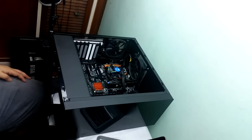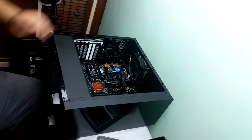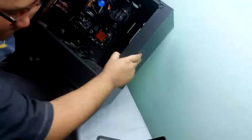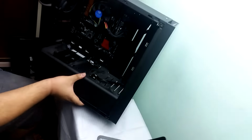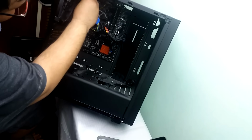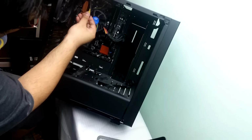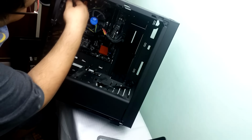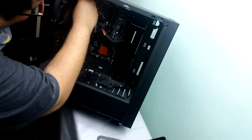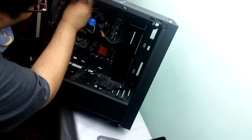We are mostly done. We're just gonna have to connect all of the needed wires onto the motherboard. We can start with the 8-pin on top here. Here's the 8-pin CPU power. Here's my 8-pin cable. It doesn't go on the wrong way, so you gotta keep it in mind. Actually, wow, this motherboard has the cable upside down compared to the other ASRock motherboards. That's new. Alright.